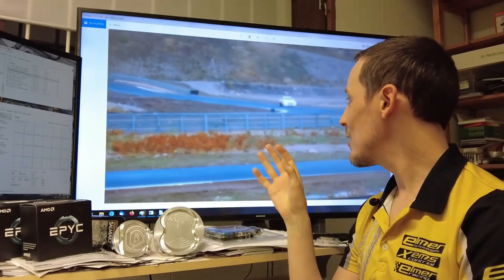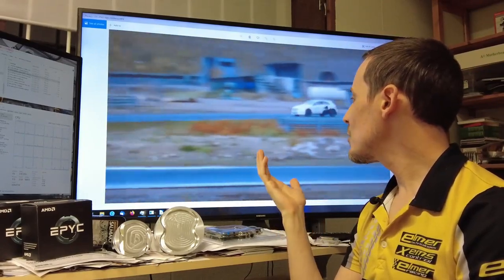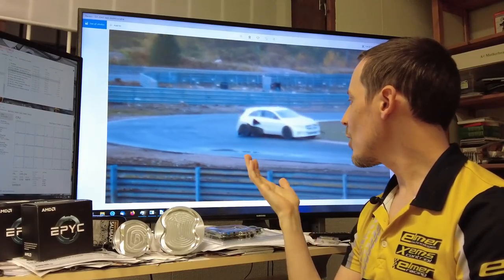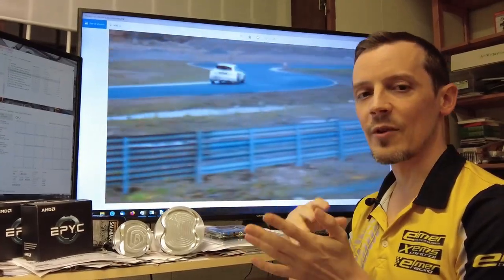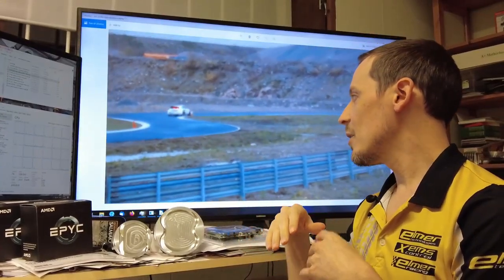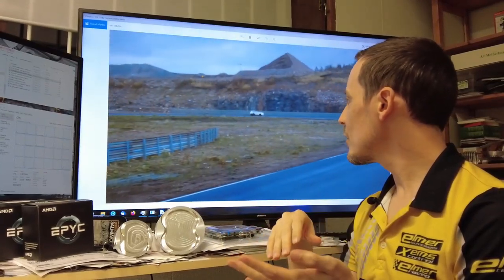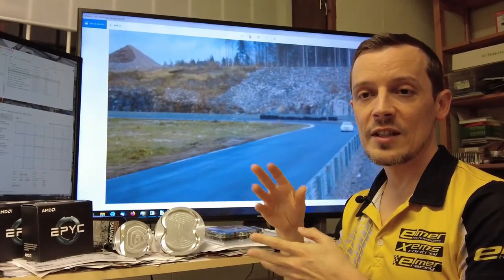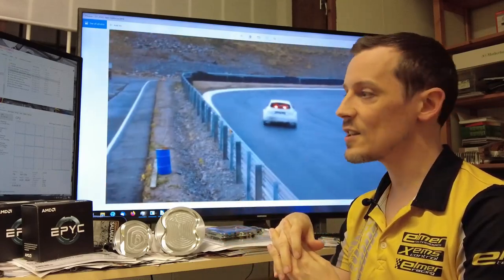That part of the ECU setup is very, very good. You want to check how the engine performs in dynamic situations — so at lower RPM, how the anti-lag stuff works with different throttle openings, what your EGTs are in actual track racing situations, and the launch control stuff. All of this needs to actually be done in a real chassis rather than on a chassis dyno.